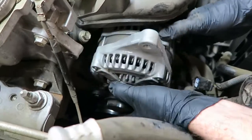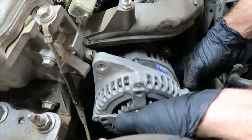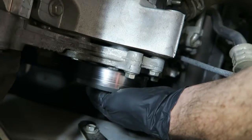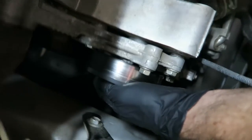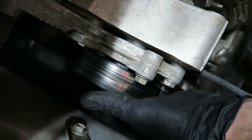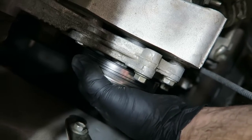Take your time — you just have to unseat it from the lower cradle. It's been wedged and you pop it right out. More is less: take as much apart as you can to access the part you're after. We've got the alternator moved down. You can see the play — it's not as bad as it could be, but you're going to grab that pulley and see if you've got lateral play.